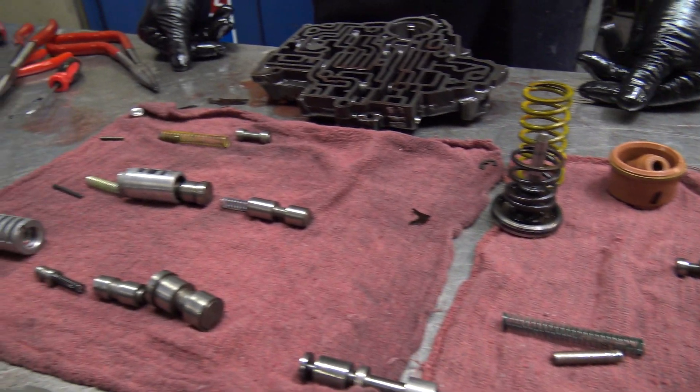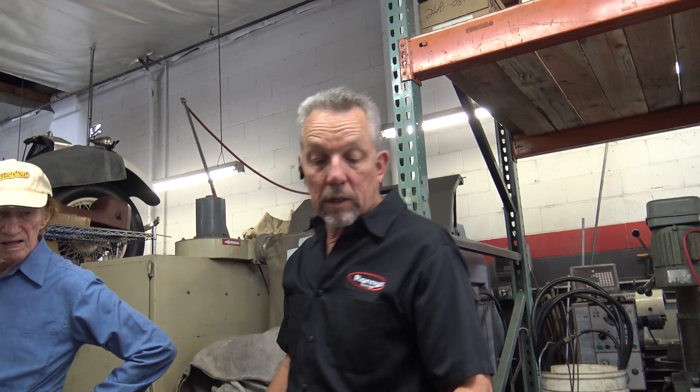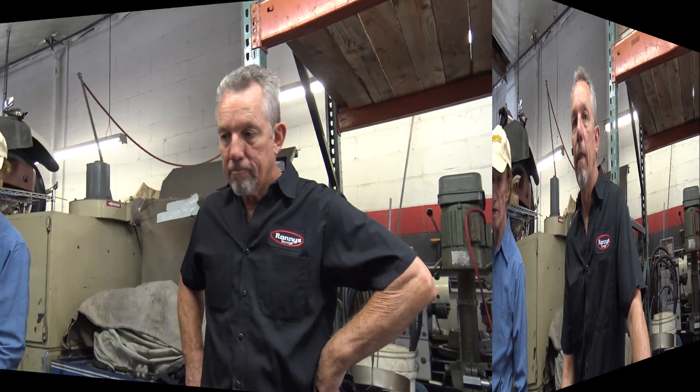When cleaning this — as far as the bores for these valves — do you use anything like brake cleaner? I usually put this in a hot parts washer, like a jet washer, so it gets as much of that stuff out. And I'll use choke cleaner, brake cleaner. I will polish these and see how they go in. Sometimes, especially on that hydromatic four-speed, the aluminum housing gets dinged up and I have to work it. Sometimes I'll get in there with a bearing scraper and take out any nicks or burrs — it's painstaking. Sometimes I'll give up and just get a different valve body, but these are pretty good. It's very rare that I've had any real problems; usually just cleaning up burrs and getting it clean. I usually assemble them in solvent and shake the valve — if it goes back and forth by itself, I'm happy with it. So there, we're done.